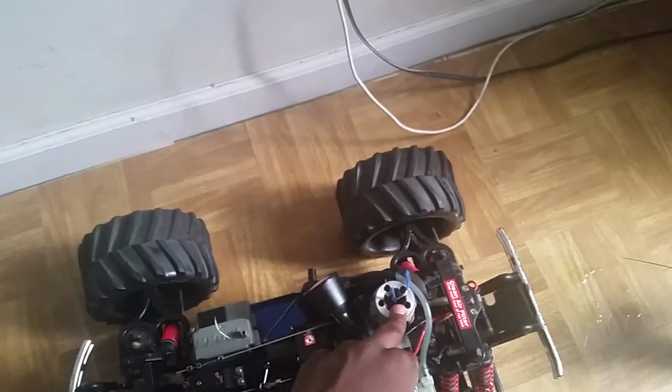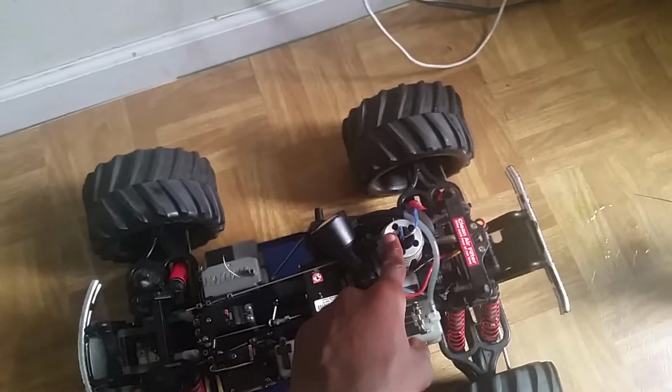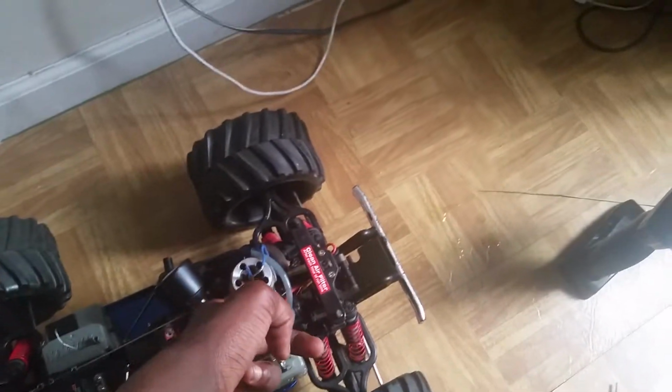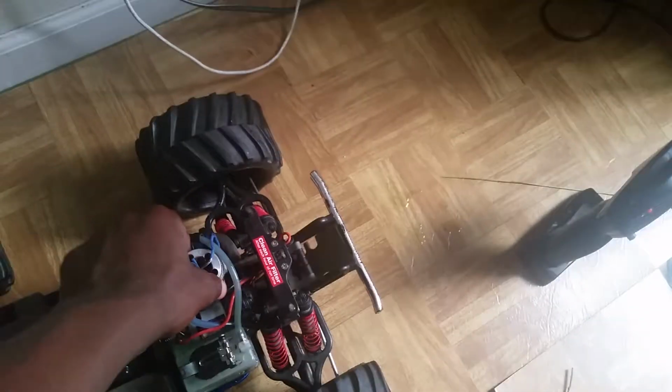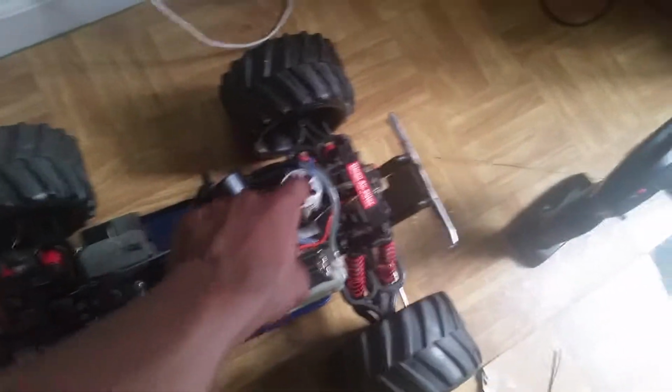You also want to test the temps of your car. You might want to lean it if you touch your cooling head and you're not getting burnt within like 3-4 seconds minimum. But if you're getting burnt instantly, you might want to richen it up, because the engine needs fuel and it needs some heat in order to work correctly, which is why they don't work in winter.